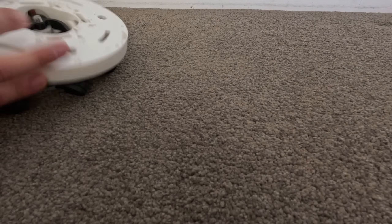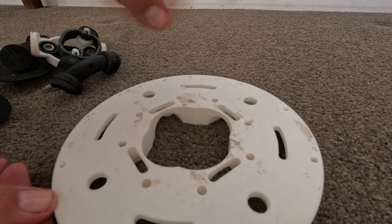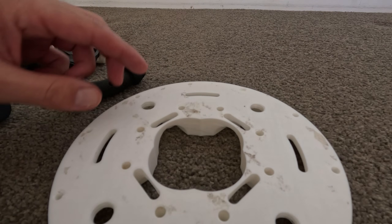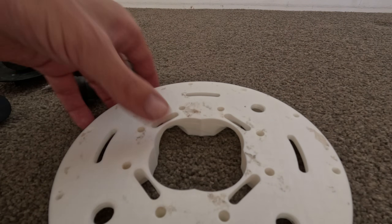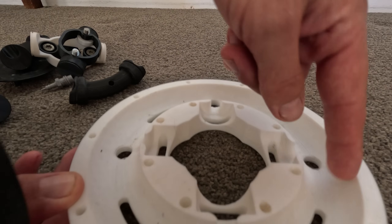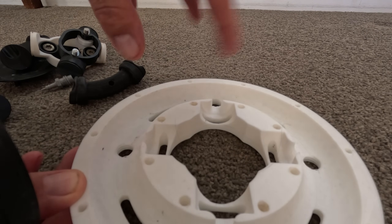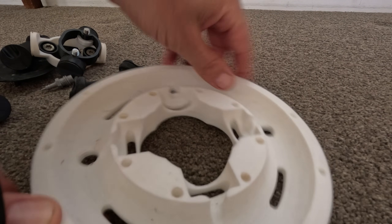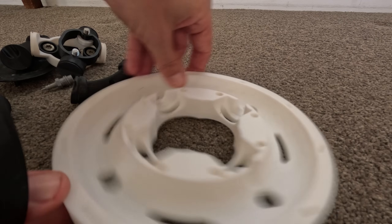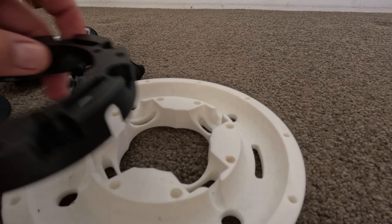On the back side, these are the intake and exhaust ports — they share ports. The good thing about this is that on the MYT engine, the explosion is always happening in one place, over and over, so you've got a hot side and a cold side which will eventually turn the thing into an oval. But since now each combustion chamber is being shared with exhaust and fuel-air, it will self-cool, sort of like a four-stroke does.